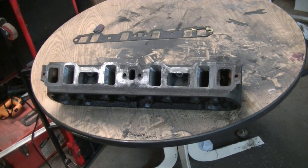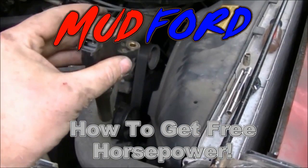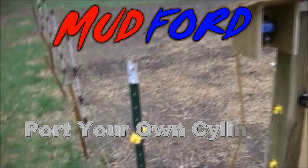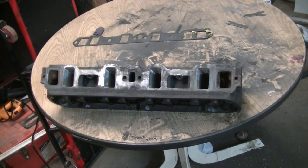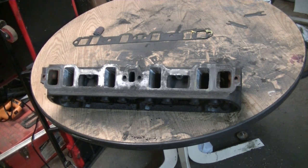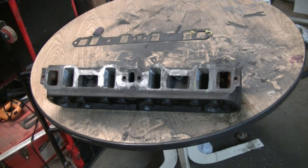It's going to cost you a little bit of time though. What I'm doing today is porting my cylinder heads. A lot of people are kind of afraid to do this and maybe send it out and spend a bunch of money to get it done, but I'm just going to show you the basic, easy way to do it yourself. This video is for do-it-yourselfers who might be rebuilding their engine, slapping some rings in it, freshening it up, new pistons, cam. This is just an easy way to give you a few extra horsepower. It's really not going to cost you anything if you have an air compressor, an air grinder, and just some simple tools like that.